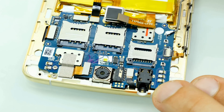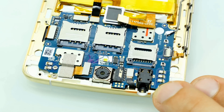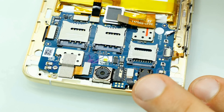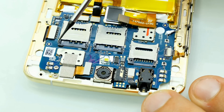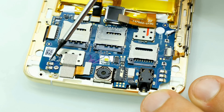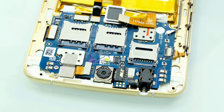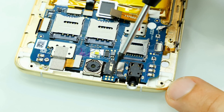Here's the fingerprint scanner — I'll later have a look at the number on the flex cable. It's connected here to the mainboard with that flex cable. There are some more flex cables here: one goes down to the bottom PCB, and the other goes to the display. You can see several contacts here — those are the contacts for the antenna loop in the back cover, as we've seen before. And here we have some test points.